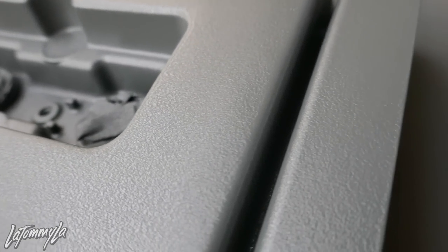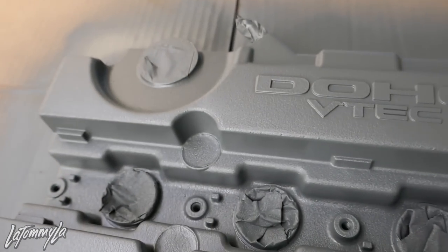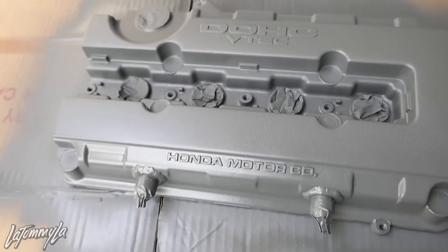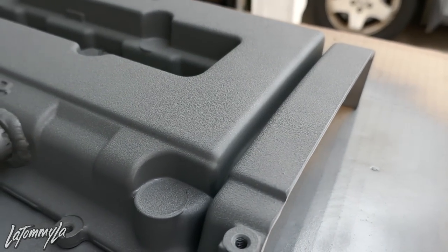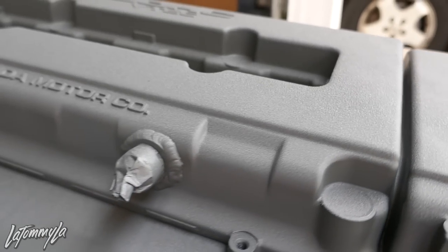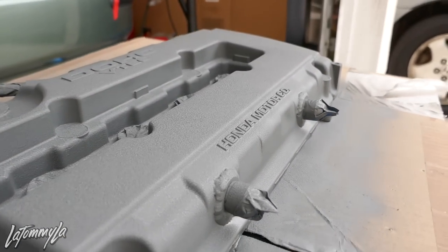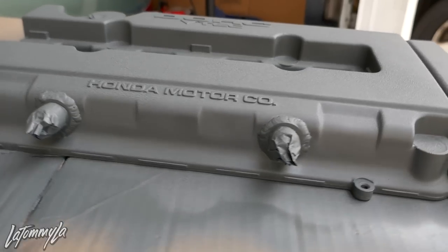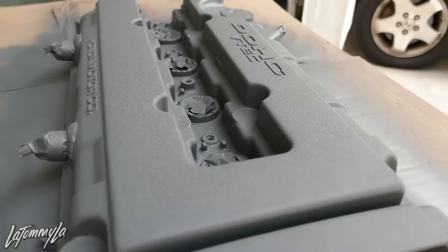You guys can see it now — slowly but surely, getting all that wrinkle out. I love this color, oh my god. So this is after some time — it still needs to cure though. I'm just going to leave it for 48 hours, so it'll be two days before I even sand it down. But this is where we are now — I just have to take off all the tape, sand it down, and it should be looking like a valve cover like my car.